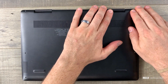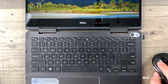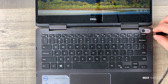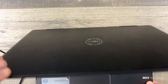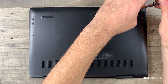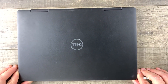So I think we have it figured out — a piece of plastic broke off from the receiver and was stuck inside the USB port. That is likely what was causing the resistance when plugging in the receiver. Now I know the USB port works but the mouse doesn't, so it's time to try out a new mouse. This is one of my favorites — the Microsoft Mobile Mouse 3500. I plugged it in and almost immediately it was recognized. I also plugged in a wired mouse and it too was recognized almost immediately. So with that, it seems we solved the problem. When the computer fell it probably landed on the USB receiver, breaking off a piece of plastic that blocked the adapter and may have damaged the port. By cleaning out the port we removed the broken piece and solved the problem. Unfortunately the receiver is broken but a new mouse works fine. We didn't have to do any soldering, so that's always a win. I'm glad I could help out my neighbor and I hope it helped you too. Thanks for watching.